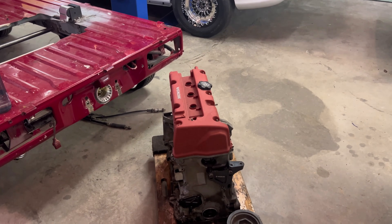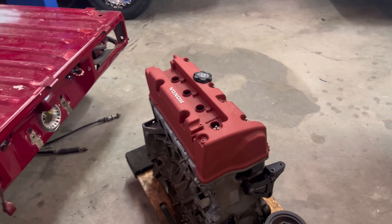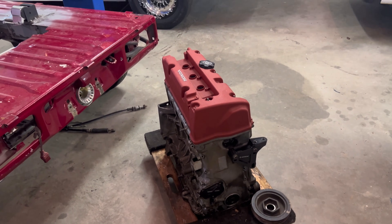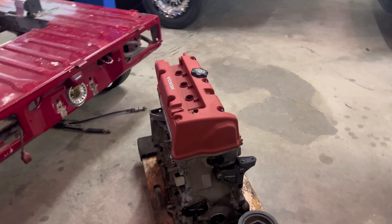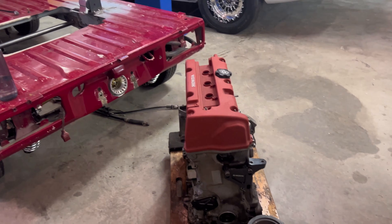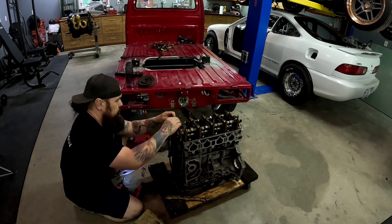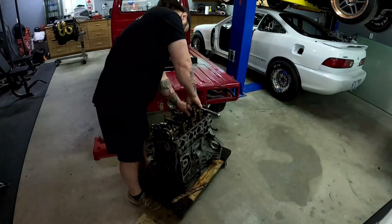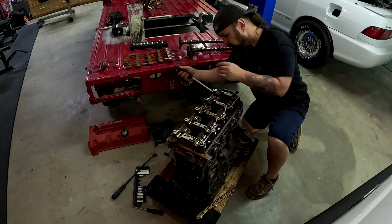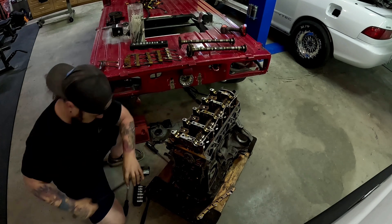The K24 is out of the truck. I don't have a free engine stand right now, but I'm going to go ahead and break this thing down on the ground, get the head off, and get it to the machine shop tomorrow so I can get it cleaned up and refreshed — I want to get it back in the truck as quickly as possible so I can get to wiring. We're making a little headway on getting the head off — got the lost motion assembly out, got the cams out, getting ready to pull the spark plugs, and then start working on breaking the head studs loose to see what kind of mess we actually have between the top and the bottom.